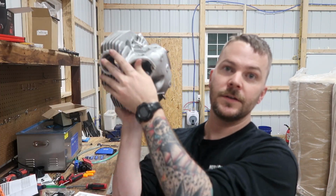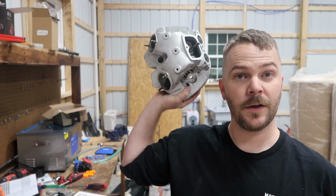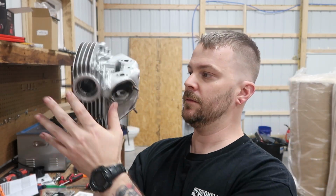Alright guys, that's going to conclude it for today's video on disassembling my Norton Commando cylinder head. And then I vapor blasted it for fun. Well, not for fun because it just looks about 1,000 times better and it deserves it. And so now I have to go through everything, order all the wear parts, see what I need. I need to pressure wash this, run it out with air as well, probably pressure wash it again, run out with air again, just to make sure all the media is out of the head so there's no possible media that's going to be in there because that will destroy this engine, so that's not good.